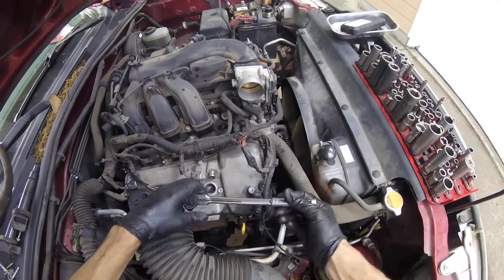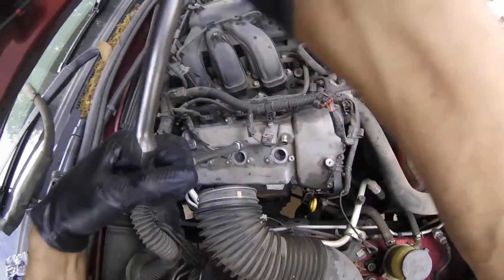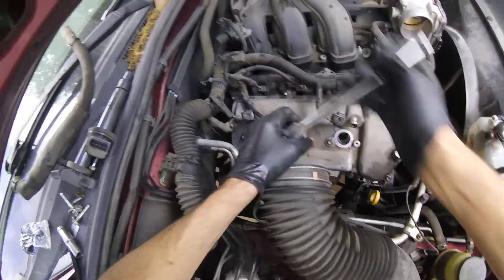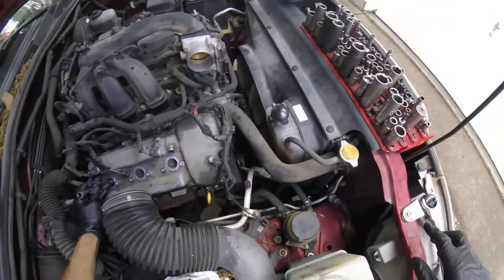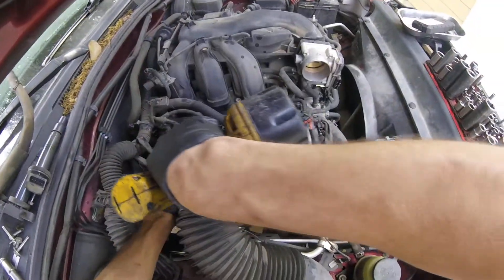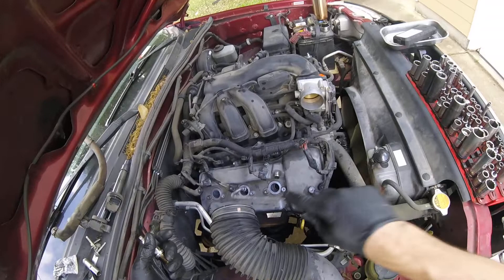What I like to do is break it loose, and voila! Just get it out with a magnet, or you can put these in to get it out. I use this tool here. Then just make sure you gap your plugs before you put them in.